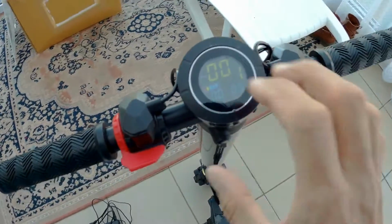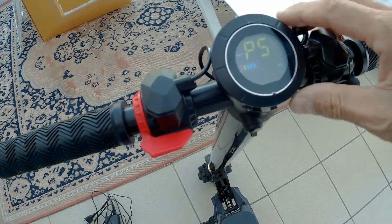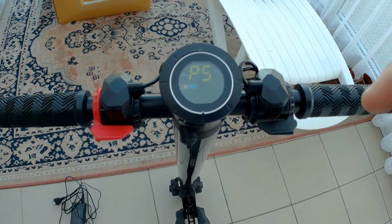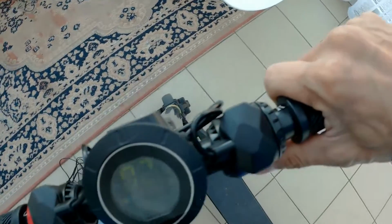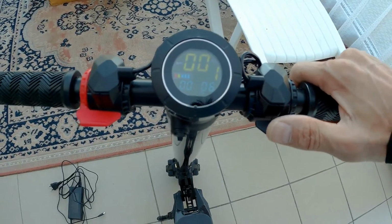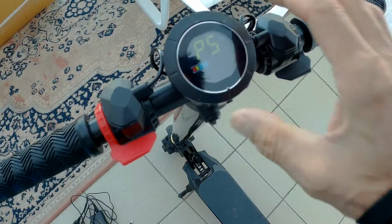This in the menu will be a supplemental security. By default it was on 0. If it's on 1, let me wait until the time is out. When I push the power button, the motor will not start to spin. It will only start to spin if you push the device, as you can see. So you need to push to start, and then the engine will start to roll. I think it's for supplemental security. So let me put it back to 0.